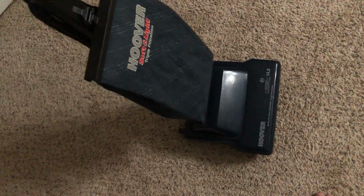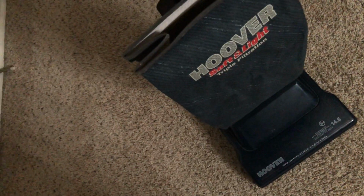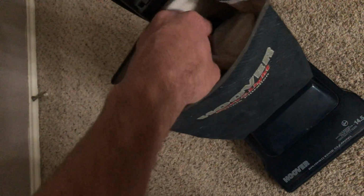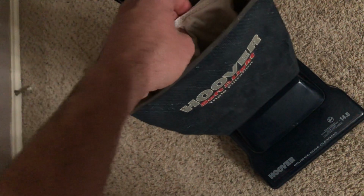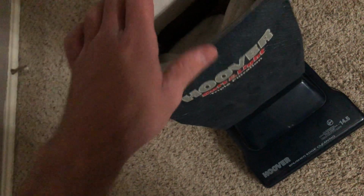So, like I said, this one being one of the more basic models, it does come with the slide top bag, so you just pull that bag off and slide the clip off on either side to get access to your inner bag, which, just like any of my other Elites, is running HEPA cloth type A bags for increased filtration. They filter so much better than even the genuine paper bags of the time do.